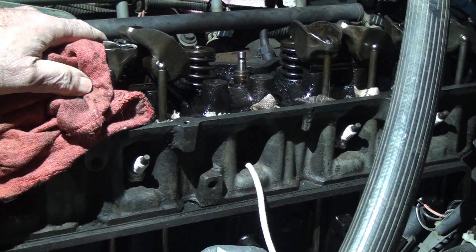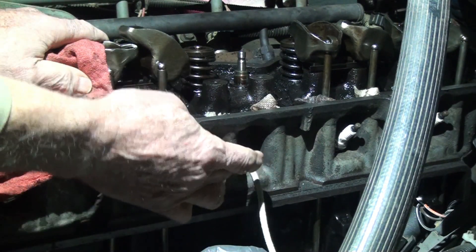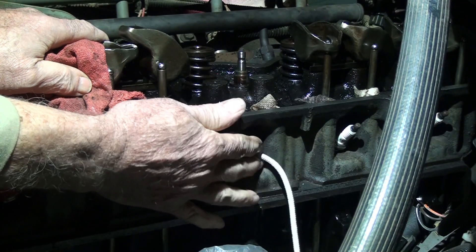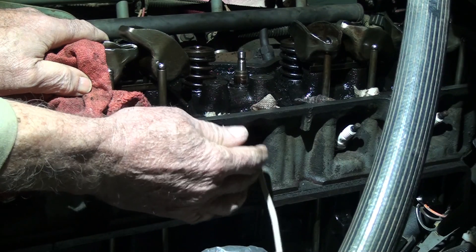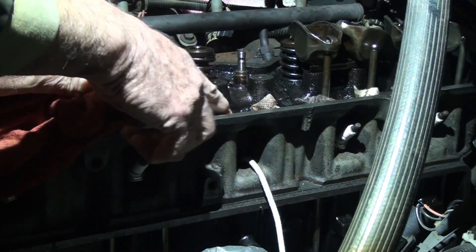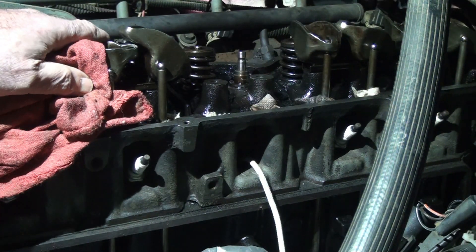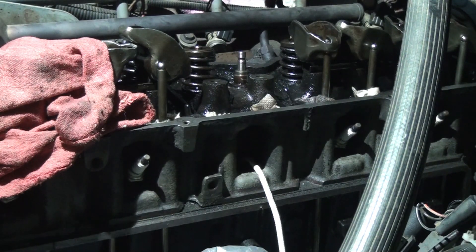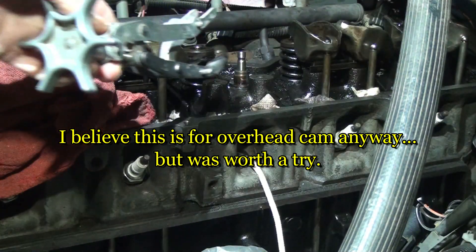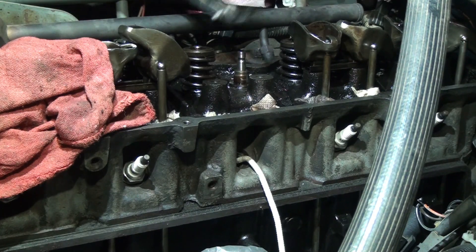When it came time to free up the valve, I needed to take the valve spring off. So I brought number four up to top dead center, put some 3/16ths clothesline rope in the cylinder, filled it up as much as I could, and plugged up the little oil ports on the side. I didn't have a spring compressor that would fit — I thought this KD Tool spring compressor would work, but I can't really get into it because of the air pipe on this side.